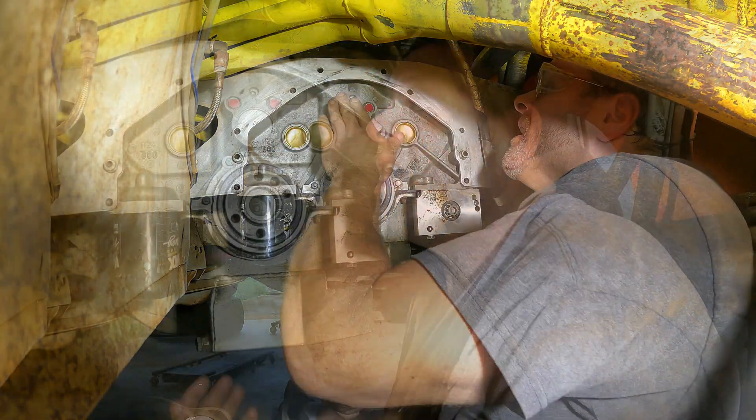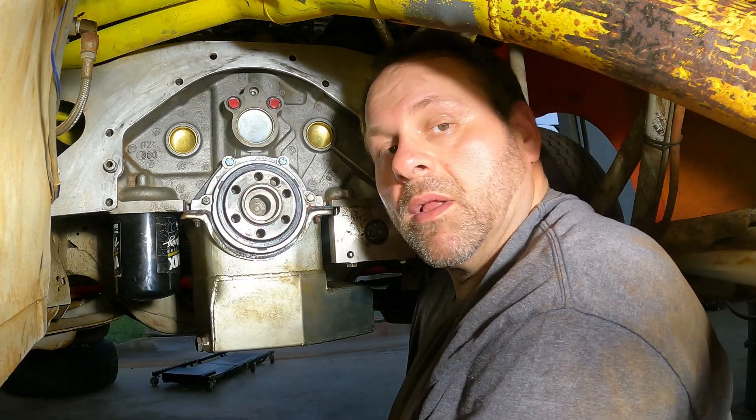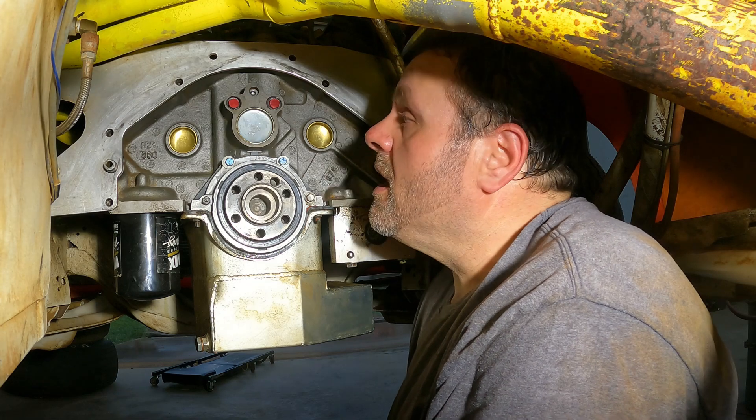Not that big a deal. You saw I even modified the block for them to work. They also make them with an Allen bolt in the middle that would have gone all the way down in there, but same difference to me — just clearance them and I don't have to worry about it. While I've got the flex plate off, I'm looking and I don't have any oil leaks going on back here, so I'll make sure these bolts are tight while I've got the chance, then get it all buttoned back up. Just a quick one here — wanted to show this since I was doing it because I am tired of oil leaks and we're just going to stop all of those gremlins. I've got the transmission on the tool bench with the rebuild kit sitting there in the plastic — that one's next. See you next time.